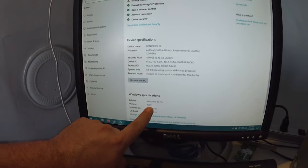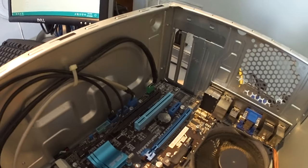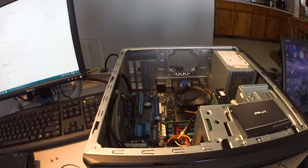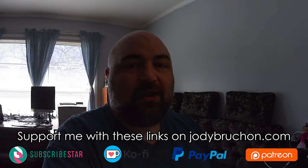The ultimate solution to this — I did get it to 1909, so it is running Windows 10 1909 now, despite me cutting it off after it froze during the update. The thing I ultimately found is a forum post where a couple of people ended up mentioning that this was the culprit. This is an Asus wireless adapter — a PCI Express wireless adapter that was down here in the corner of the computer. I got it up to 1909, but I don't think that's what fixed it. I think removing that PCI wireless adapter is ultimately what repaired this computer. So for anyone who has an Asus Essentio CM1740 and has Windows 10 freezing on restart, take out the PCI Express wireless adapter and get another wireless card if you really need wireless. Hope this helps. Have a good one.